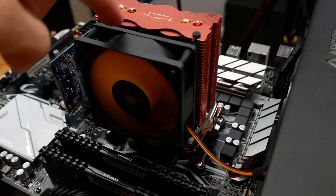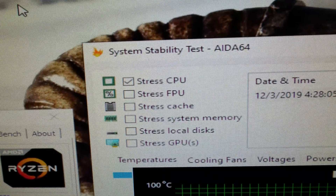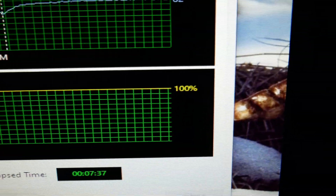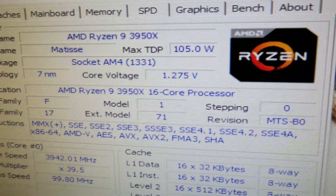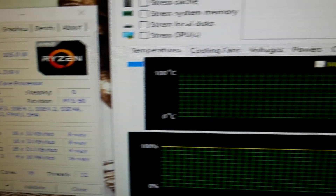What's interesting about this cooler is it's actually not obnoxiously loud. In AIDA64, we're doing the CPU stress test first because I know it puts less temperature load on the CPU than the FPU test. We're sitting right now at 81°C, bouncing around there for a while. We are pinned at 100% utilization. In CPU-Z we're running at 1.275 volts and bouncing around near the 4 GHz mark with Precision Boost Overdrive. Things seem to be pretty smooth at this point.